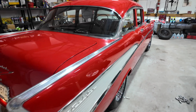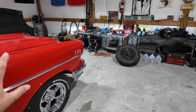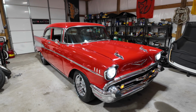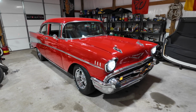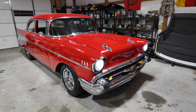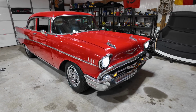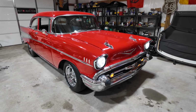I had several people looking under the hood of this car, and they told me that this is a 300 horsepower, if it's stock anyway. If it's a stock motor, and we know that it was rebuilt along with the transmission, but if it's stock, it's a 300 horsepower. I think it's a 327 with a large journal crank because it has a balancer and a center bolt on it. Of course, you got those ram horn exhaust manifolds that are some of the best flowing exhaust manifolds ever made by Chevy. You've got the double hump heads. It's actually a stout car.